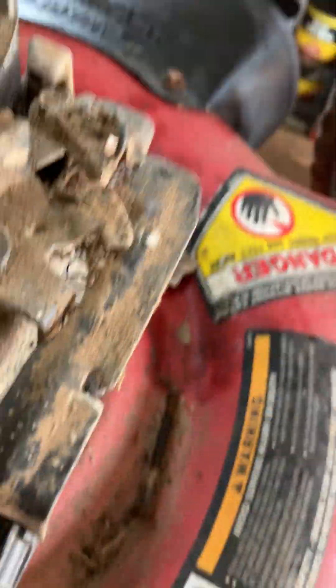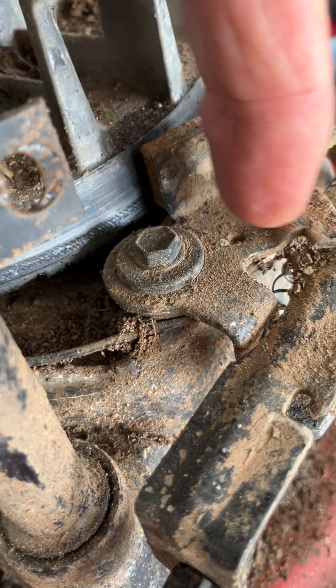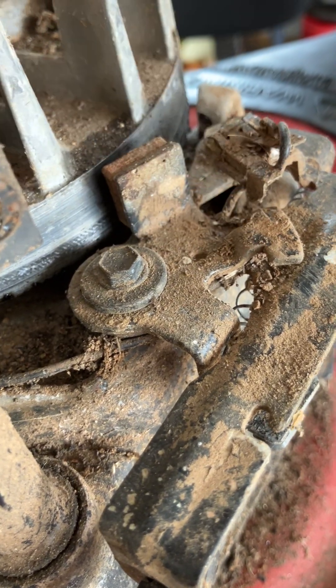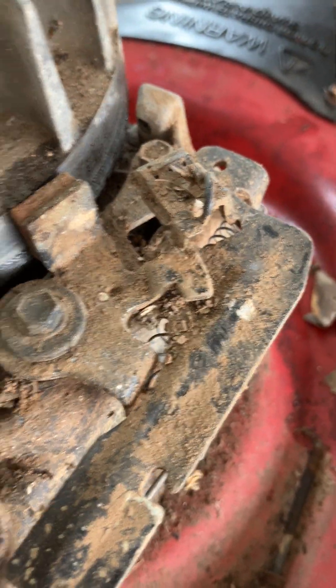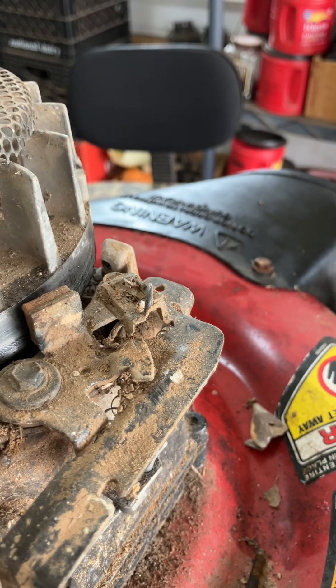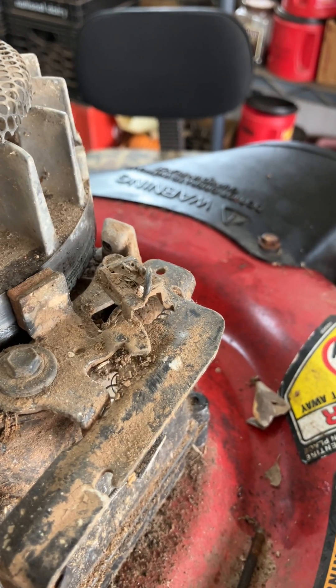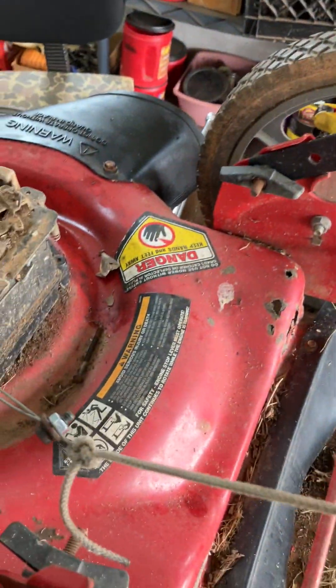Right now, you see this engine — from an electrical standpoint — will start because that is the kill switch and it's not touching. Now, when I raise this and take the slack off, that spring compresses, and now it's touching. So that is a kill switch that is good enough to work. I may tighten that spring a little bit. This cost me nothing because I had these screws laying around and the old pull cord. So that should work.